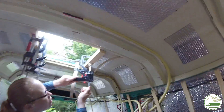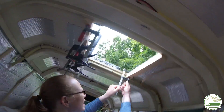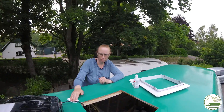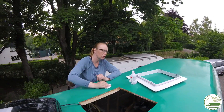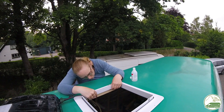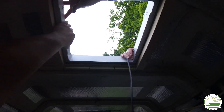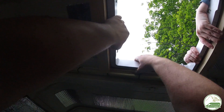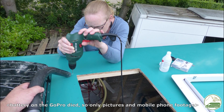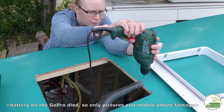These also have to be held firmly in place by glue clamps to let the adhesive cure. With the inside of the roof strengthened, we now focus on the top of the roof. First up is cleaning the area around the fan using degreaser to remove all grease and dirt. With the roof receiving flange in place, we marked all the holes we need to pre-drill, then after drilling the holes we cleaned the area around the fan again.